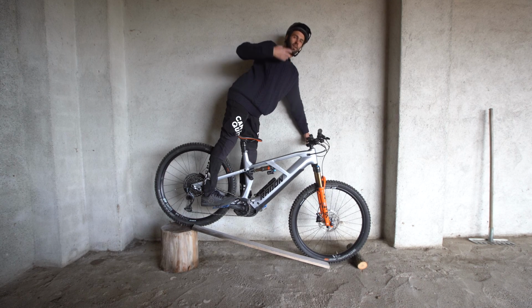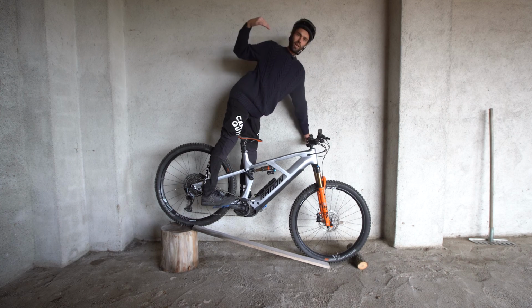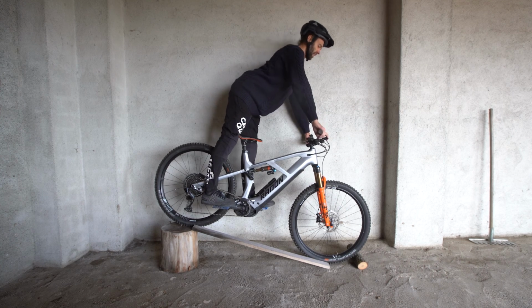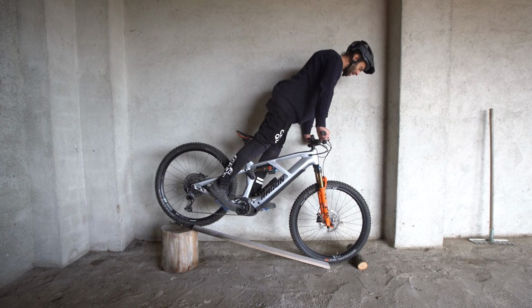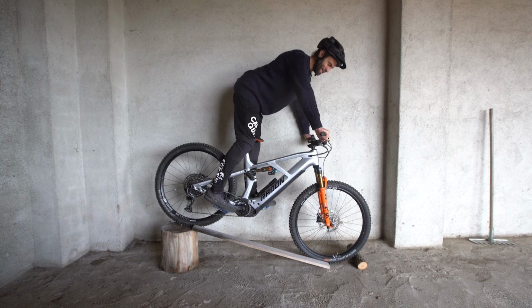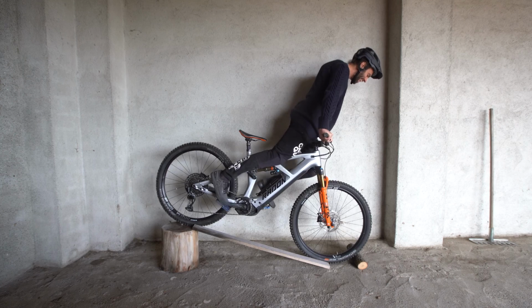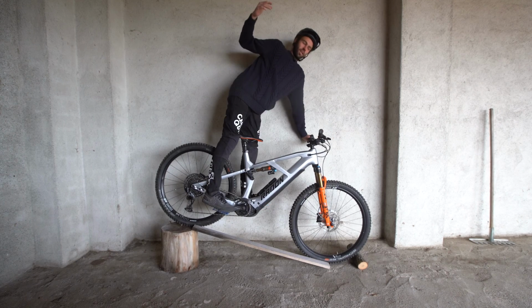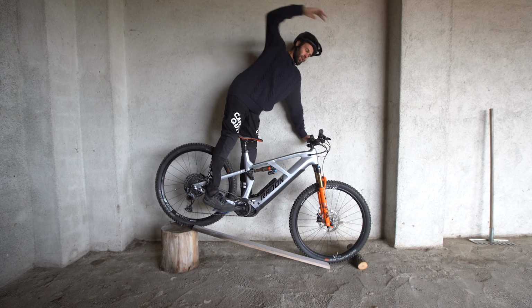taller rider has got a higher centre of gravity. So when you're going downhill and trying to brake or slow down, your weight's trying to go this way, and as that gets higher and this wheel gets closer to you, that angle and the risk of going over the bars is just increasing massively at this point. So the tall guys, instant disadvantage, stem's too long, our centre of gravity is higher, we're more likely to go over the bars.